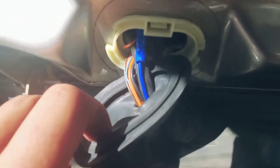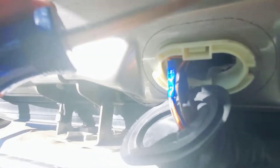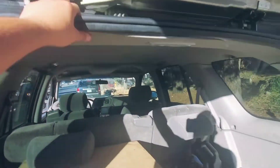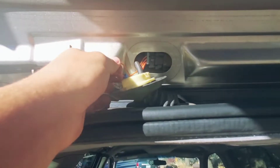Once you do that, shove it up in here. You may be wondering how to get this back on — don't trouble yourself with trying to push this plastic back onto this rubber, back onto this plastic connector. It's not worth it. Just take this clip right here, push down right there, and pull it off just like that. Put that rubber back onto this plastic clip before you push it back up into this. Here's your connector for your lift gate — all those wires connect to this. If you have any problems with your lift gate or key fob not working, it's all a module up inside here. Usually the reason it won't work is a broken wire — this black or orange one right here.